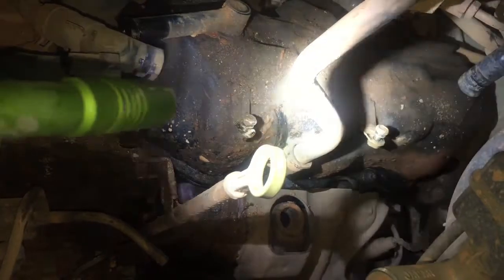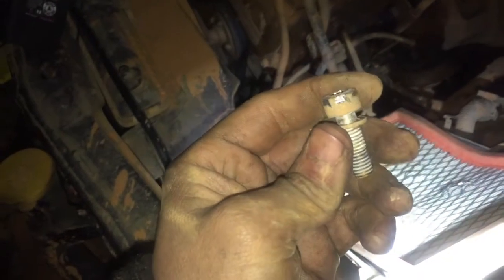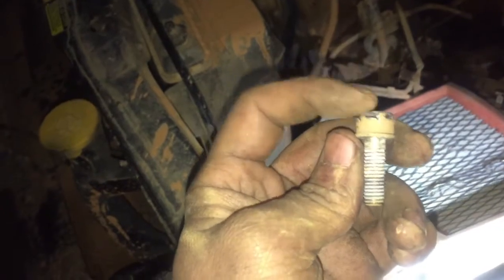Well, believe it or not, the EGR nut down there off the manifold came apart like butter. What gave me the most trouble was the intake manifold bolts. The hex inside of them was wanting to round out because they were too tight. So I had to have my ex pick up extractor sockets because mine are at work and I can't go to work for the next 10 days. So got these out finally.